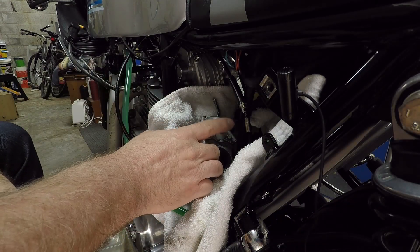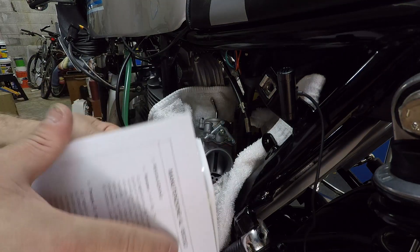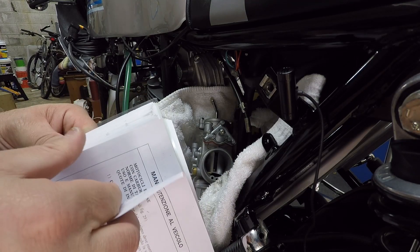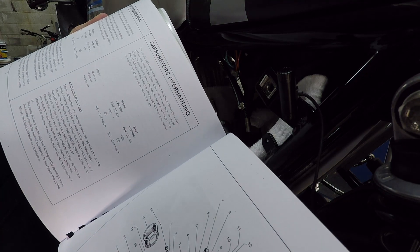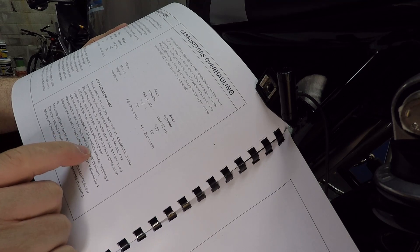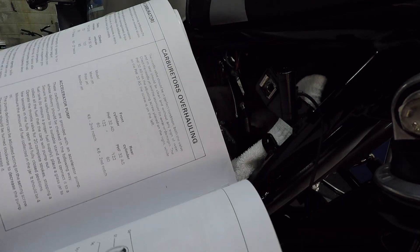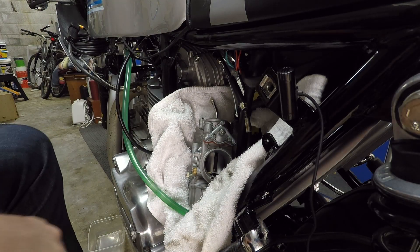If not, adjust the pump stop. If you have the PHM 32 - the little baby carb - on page 138, you've got over 20 strokes, 20 squirts, 4cc. So interestingly, half the cc. That's what we're looking for.